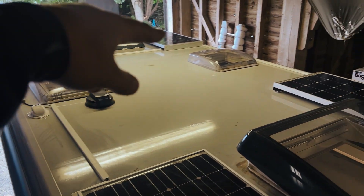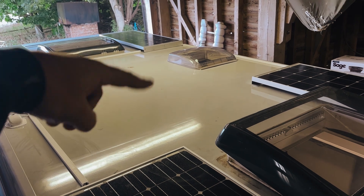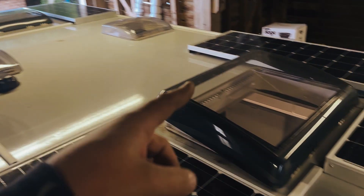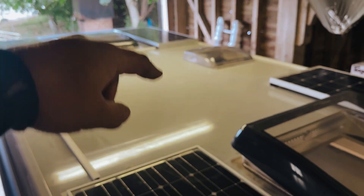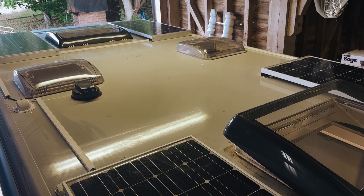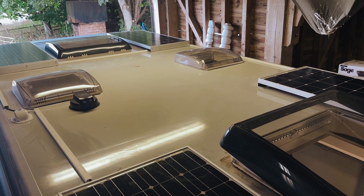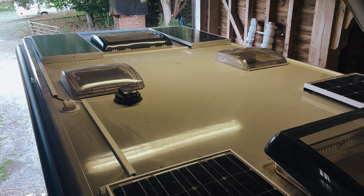And here is the roof — we've got five panels totalling 500 watts of solar, leaving a big gap where Truma are going to fit the aircon unit. The main reason the customer is getting Truma to fit it is that a lot of motorhome manufacturers will only let Truma cut a new hole for an aircon unit. Since there's no 400mm skylight here, a new hole has to be cut, and most manufacturers only allow a handful of authorised fitters to do that and still honour their warranties. So Truma are doing that, and once it's done we may be able to squeeze in potentially one more panel if needed, but the customer will see how it goes.